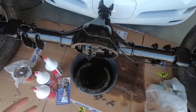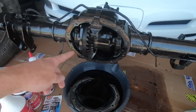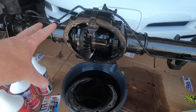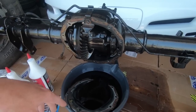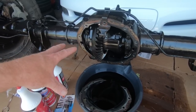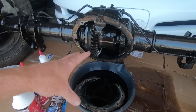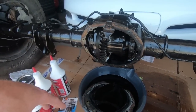So this has been draining for a little bit at this point, and I'm going to let it keep draining a little bit more, but we're going to have to go back and clean off the gasket, the old gasket material, and I've got my new oil here, and we'll talk about that in a little bit. I keep tilting it up a little bit, letting it drain more and more, but the gears look great on this thing. No wear, looks like really even wear pattern, so I'm pretty impressed with this. That truck has 160,000 miles, but these things are pretty tough, to be honest with you. Sometimes the differential goes out in them, but for what I'm doing, I'm not going to be launching this thing at the track or anything. I think it'll be fine, and the black paint really turned out really, really good.